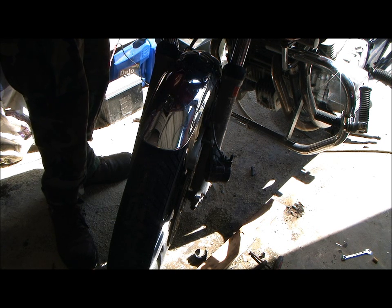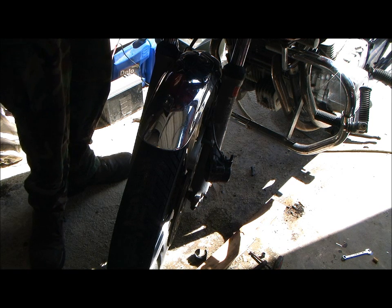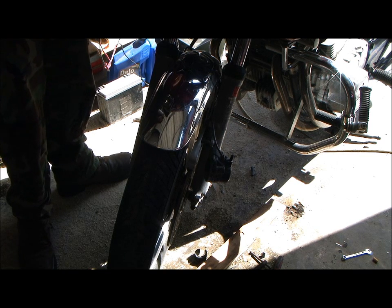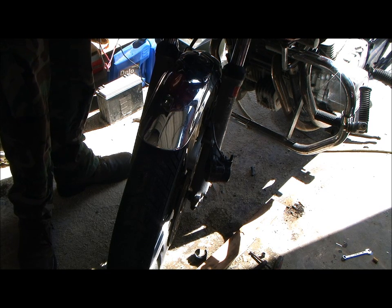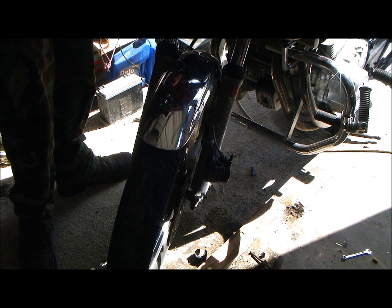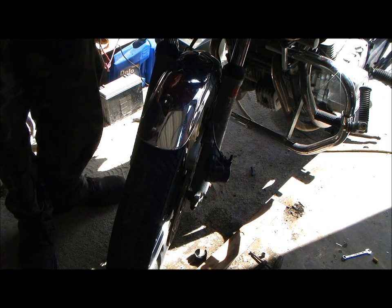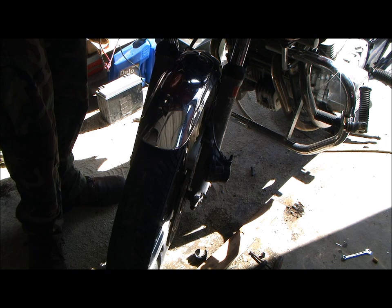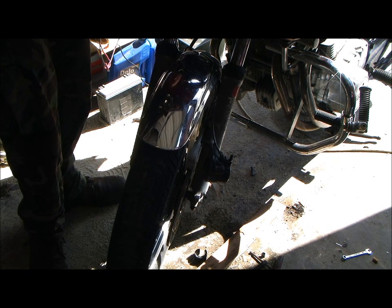I should mention that when you do this with the brake parts cleaner, this is not a job you can stop. You have to do this right away all at once. Okay, now I'm going to pump. Get this down in there. And this is going to take away the lubrication up here in my master cylinder. I know this in advance. It's going to dry that rubber out. And it's going to hang a little bit, but I know how to get around that.